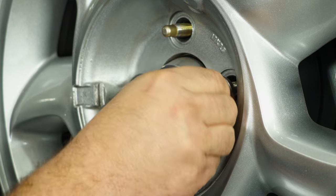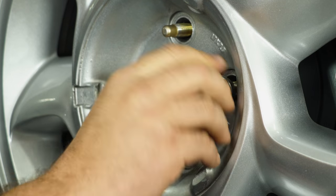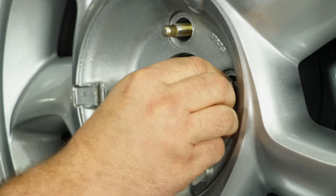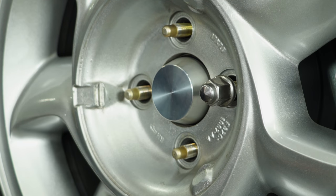If you know where to measure, put your lug nut on and try to get five full turns. If you can get five full turns hand tight before you put an impact on it, you're also good to go.